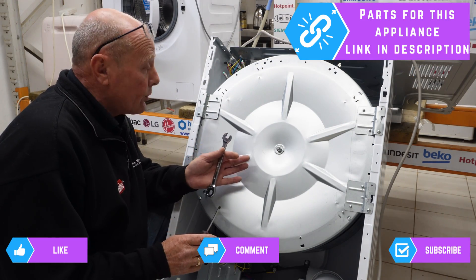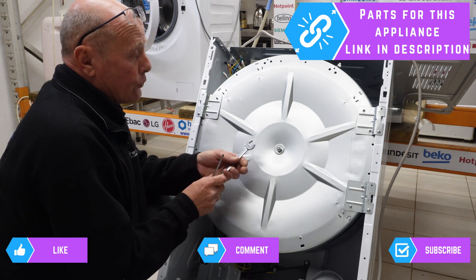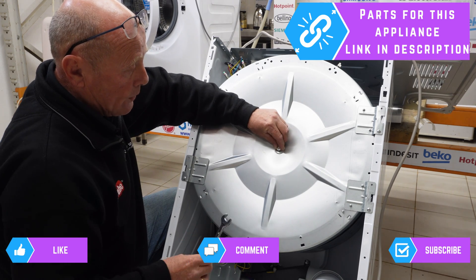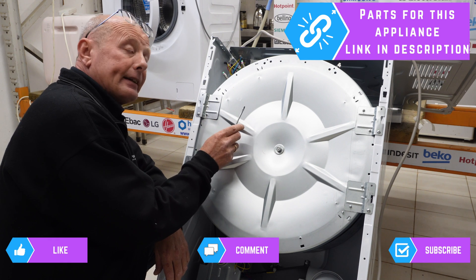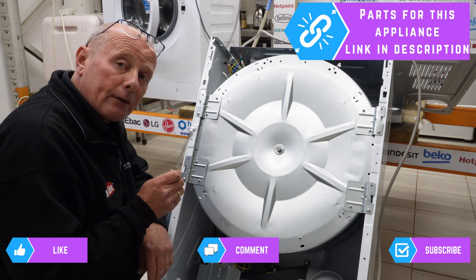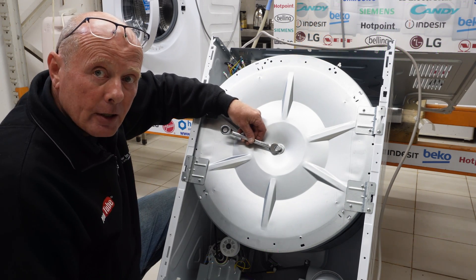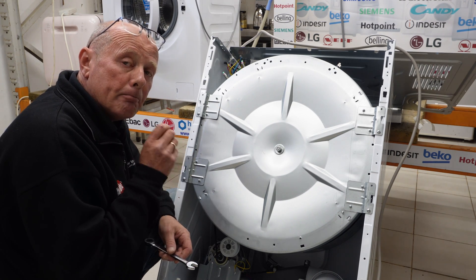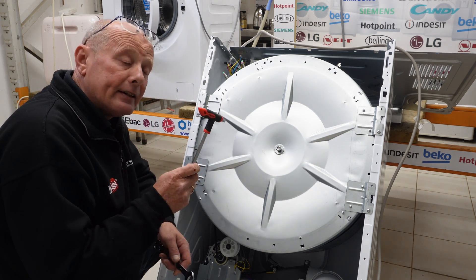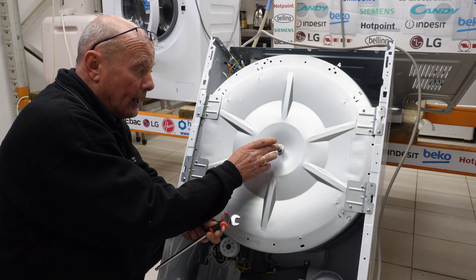This is one of the most ludicrous designs I've ever come across. Somehow they should have put a slot in this shaft bolt, because when you try to undo it, the shaft itself turns with the nut. The only suggestion I've got is to put the spanner onto the nut and give it a tap with a hammer — the impact might release it so you can get the nut off on your own. Otherwise it's a two-man job and you will need an allen key with a very flush fit inside the drum to hold the bearing shaft in place.